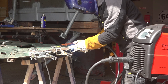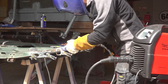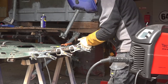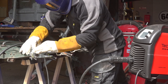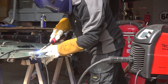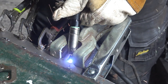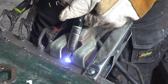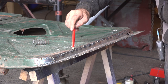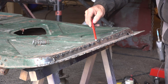Before welding I'm going to grind it down a bit more to have good solid bare metal for the weld. These clamps are extremely handy. We've finished all the welding now and it's time to clean it up. I didn't do a complete seam - that's not necessary; it's spot welded in different areas. Now let's clean that up and start working on the hinges.